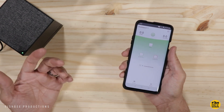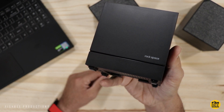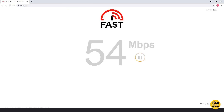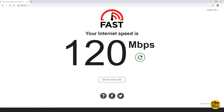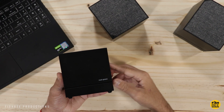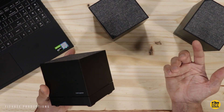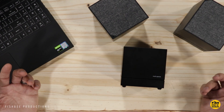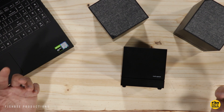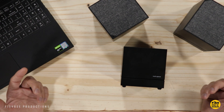After testing the Rockspace mesh Wi-Fi system for a little while, I was glad to see my download and upload speeds stayed pretty much right up there with my TP-Link Deco — maybe just a hair less. I was able to play on my Xbox One S with no problems, and the pings were about the same as my TP-Link Deco, typically right in that 30 to 50 range. Coverage for my home also seems very good, although I have to admit my house is a lot smaller than the 6,000 square feet they advertise. So as long as you don't have multiple people using a VPN network at the same time, I think you would be fine with a system like this one.